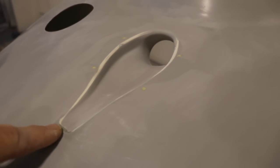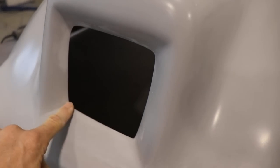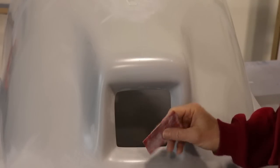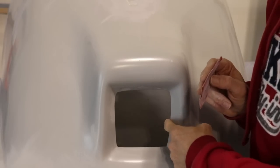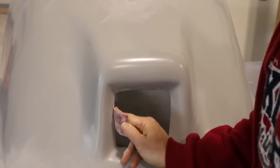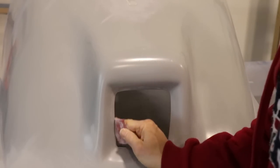I finished sanding all these little holes that I filled, so everything here is nice and smooth. I've cleaned up the hole for the exhaust pipe. One of the other things I'm working on is all of these edges — anywhere there's an edge, whether it's the back of the cowling, I take some sandpaper and round the edges. If you have a sharp 90-degree edge on any of your corners, the paint won't want to stick and that's where you'll end up getting chips. So I just take sandpaper and round it off a little bit so it's more round than a sharp corner.